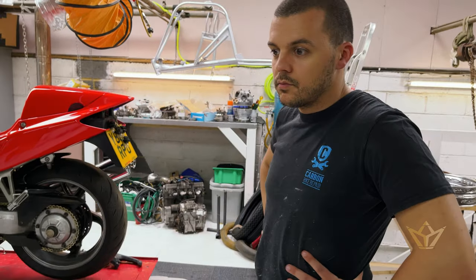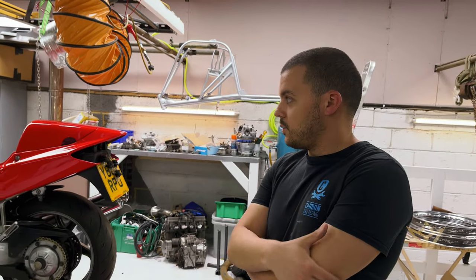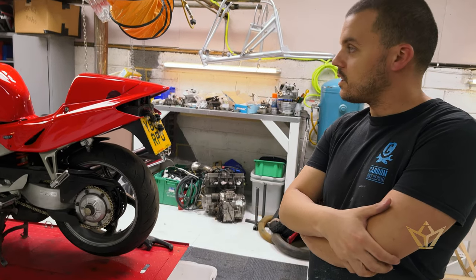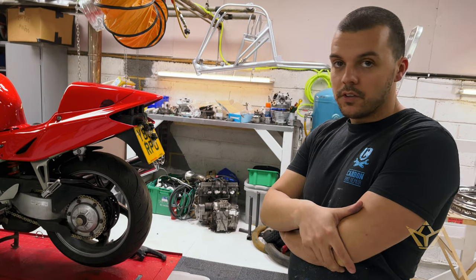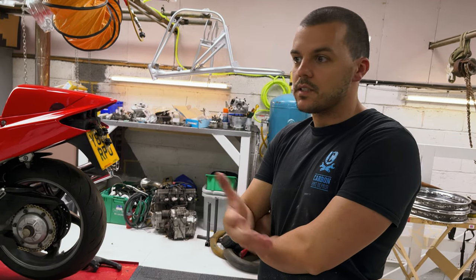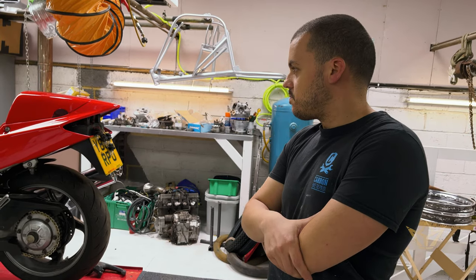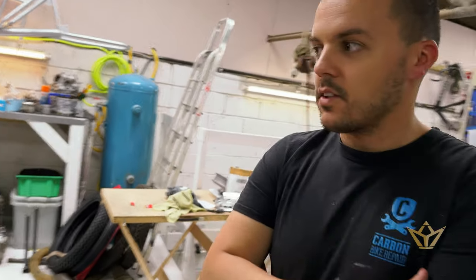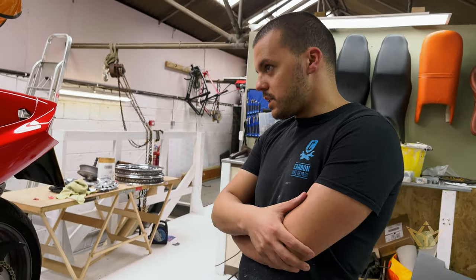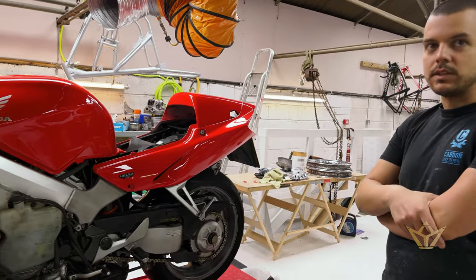So, okay, a lot of people are asking about the color that we used on this one, whether it was a Ferrari color or Rosso color from Italy. It was a handmade color, basically, and we mixed a bright red from Honda with 25% of Lumo red, which is one of these very, very bright reds that we've got out there. Okay. So it's not something you can just get out of a tin? No. It has been mixed. I think that the bright red was not bright enough, so we just decided to add a little bit more brightness, so we added that little bit of percent.